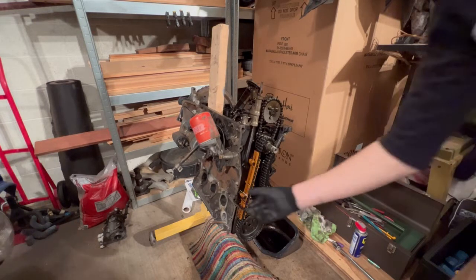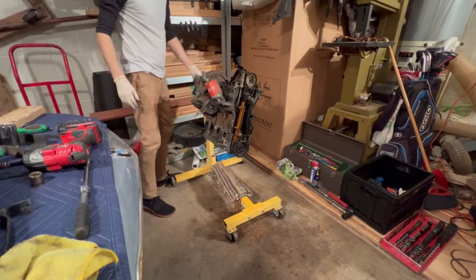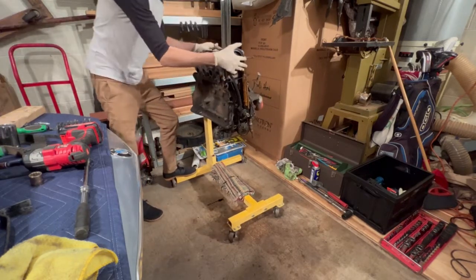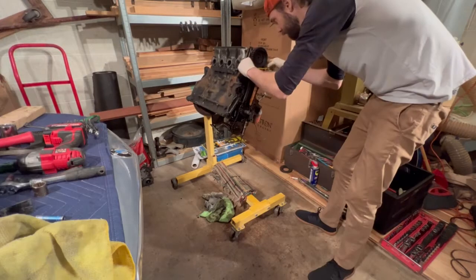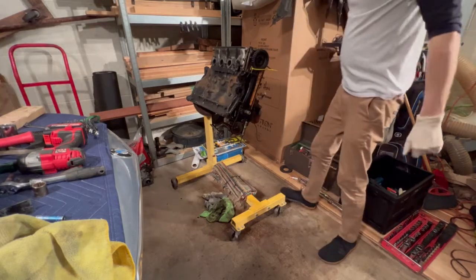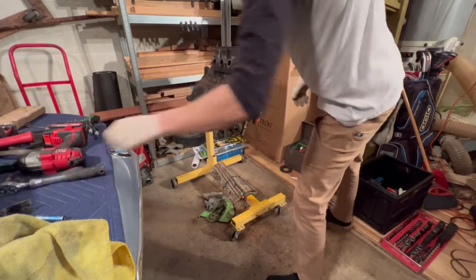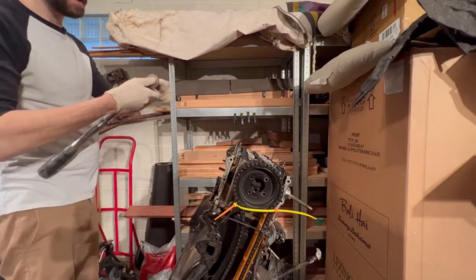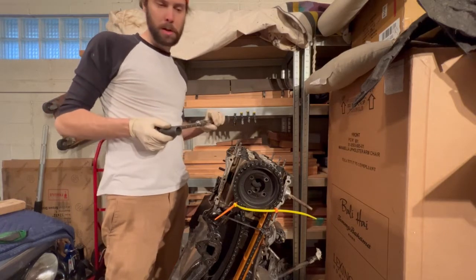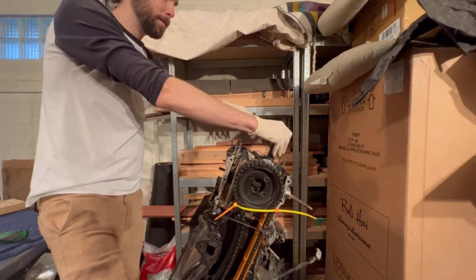I might not even take the timing chain off because I don't really see the point — everything looks like it's in really good shape; the tension rail and guide rail look okay. First episode was 'man struggles with simple machinery,' and now 'man struggles with freaking zip ties.' Break those head bolts loose, get this cylinder head off, and we're done for today. This is kind of a big moment because I don't actually know which pistons are in this engine. I know they're high-compression Euro Tii pistons, but there are two different variations, and I know only one set works with the Tii or E12 head. Let's find out.